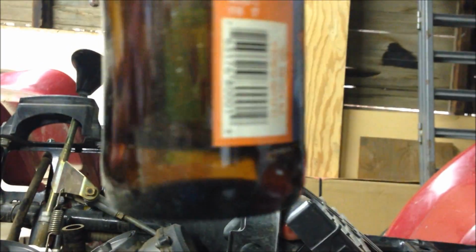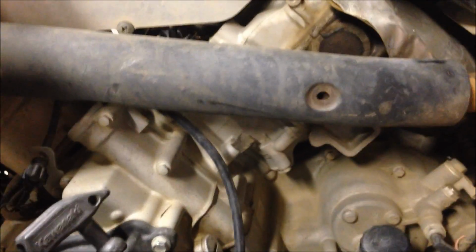Basically, that just gets tucked on your motor behind this clip, and then tucks down kind of behind your dipstick. So that's where you'll find that. And if you look, you'll see where it branches off and connects into the two bowls of the carburetor. That way you got your carb drained. You're not going to have any issues. You can see it's done. Not a lot of gas in there, but enough. So anyhow, do that, and I'm getting ready to pop the carb off, and I'll pick up from there.